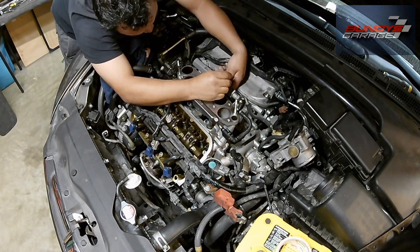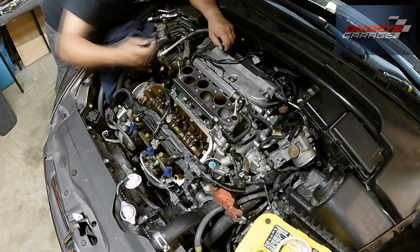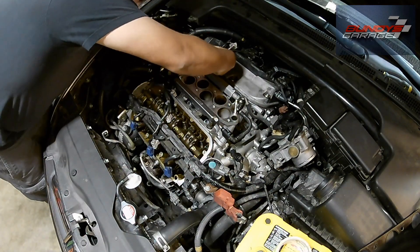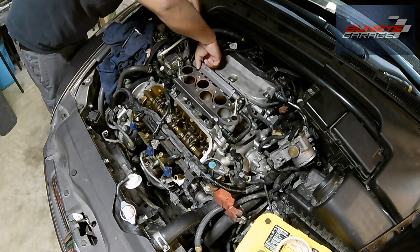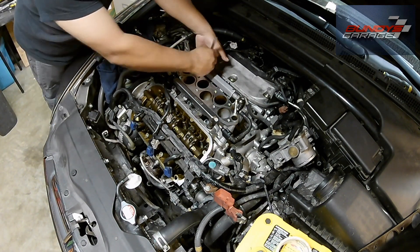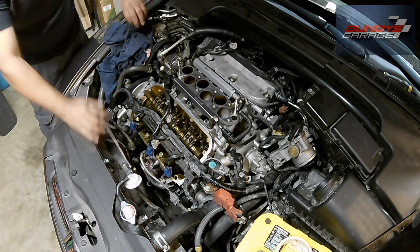I'm just getting the rear ones — the two 8mm bolts on the rear. I'll put a link in the description below, I love this set. I also use it for the tensioners on this particular engine. You can see I have a magnet using that to get the last bolt out because you don't want to drop it down there, especially if you're not taking the lower intake off.